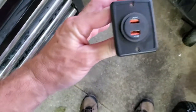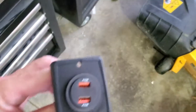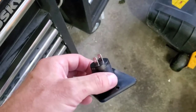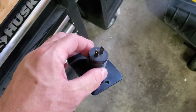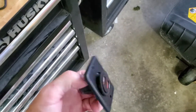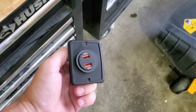In this case, I will be mounting this new USB charging port back into the cover plate of the one that I drilled out. I cut the wires on the old one in the wall, will crimp on two spade tips, plug these on, and tape them into place so they're secured and don't work their way loose going down the road.